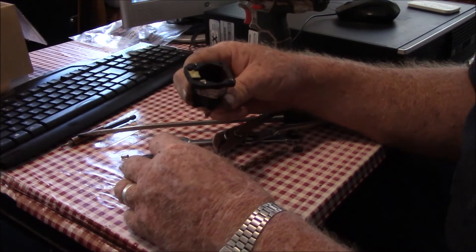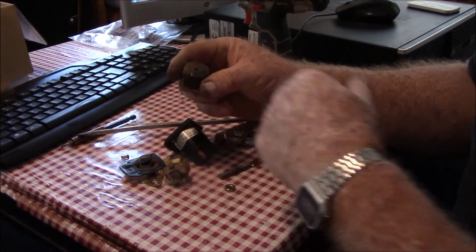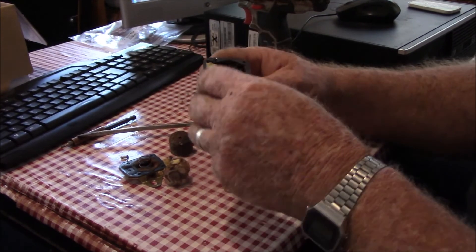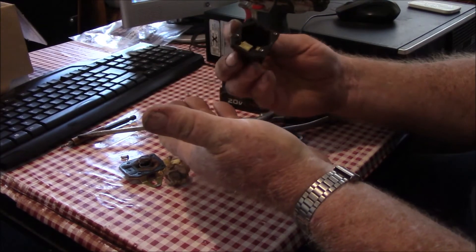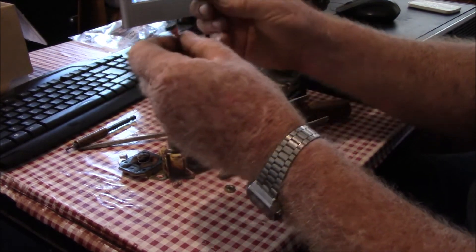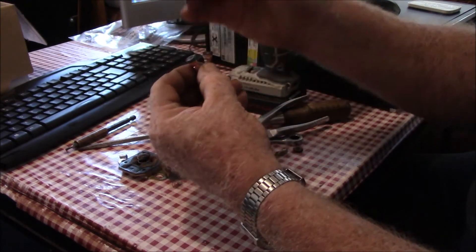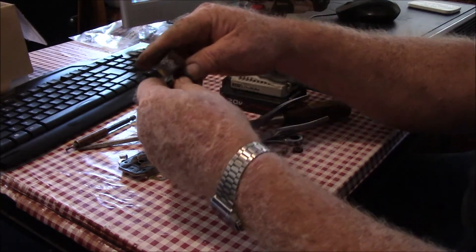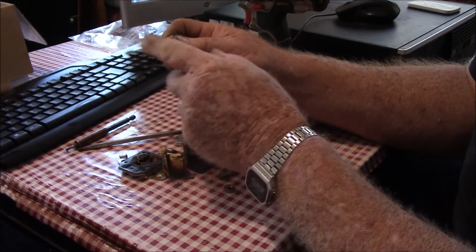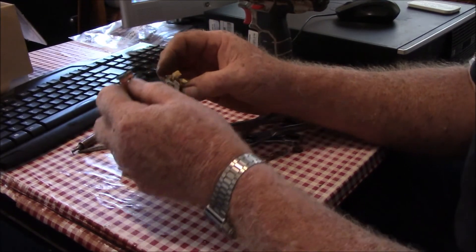Now this one's somewhat different, but man can I see why it didn't work. Look at that — it's wet and totally rusted. This has got to make contact in here with these two little gizmos. Look at the rust, look at the corrosion on that. When it's in there working right, these are a little bit apart. This thing is thrown down by the electromagnet causing contact between the two. The battery is hooked on here and when you run your starter it's here, so you're closing the circuit — pulled down by this electromagnet here.